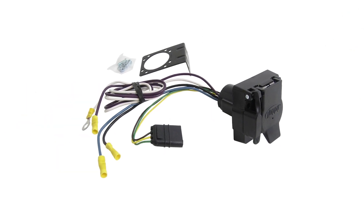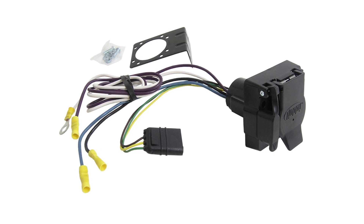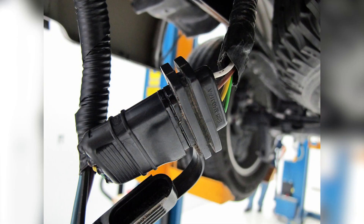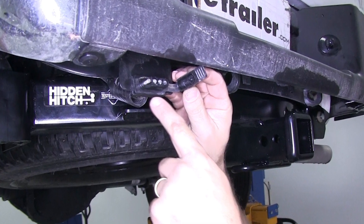The ETB-C7 is a universal kit to allow you to install a brake controller on your vehicle that already has a 4-Way Flat mounted on it. This kit also allows you to run the 12-Volt power supply back to your 7-Way, as well as your brake controller back to the 7-Way. On this particular vehicle, there's already a 4-Way Flat from the factory that we'll be tying in with.